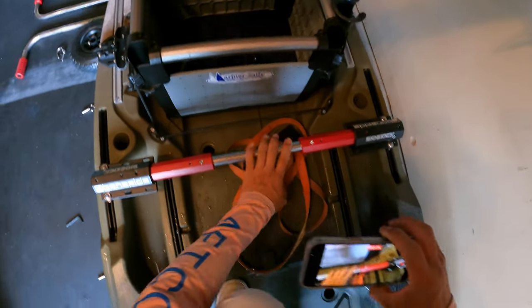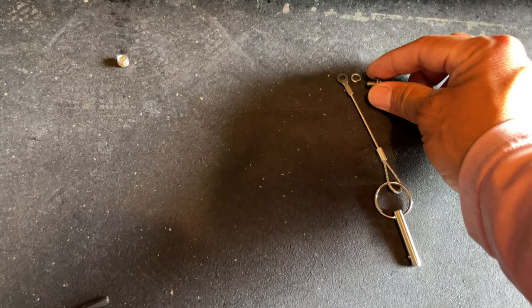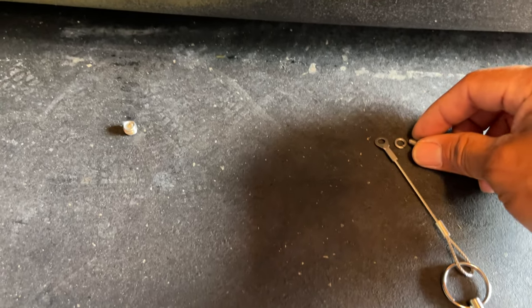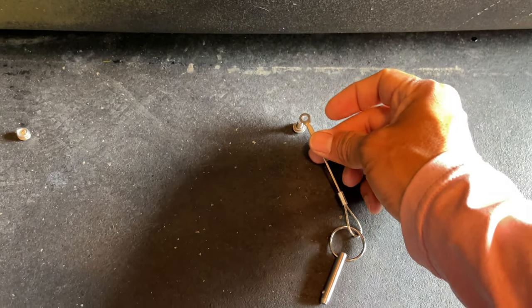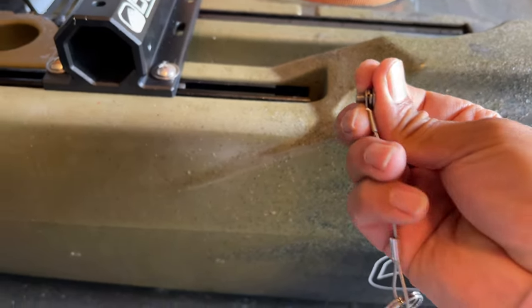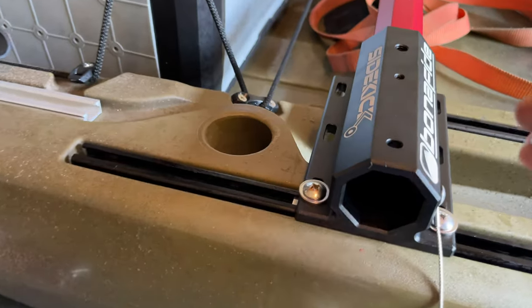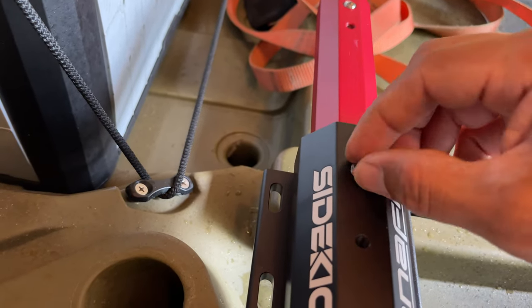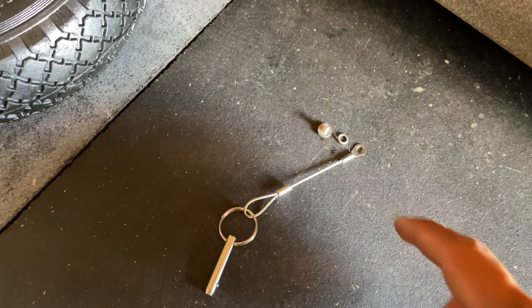It took a little bit of force right there. Next step is to get all of this hardware out of the way. I'm going to take these locking pins and place them on the hole right here. You'll take the screw, the lock washer, and then the actual flat washer piece attached to the cable on the locking pin. Right now we're just going to finger-tighten it — I just want to get that out of the way. This is going to go right up here, finger-tight because we'll still need to make some adjustments. Then the other one over here to this side, and we're going to repeat this on the other side.